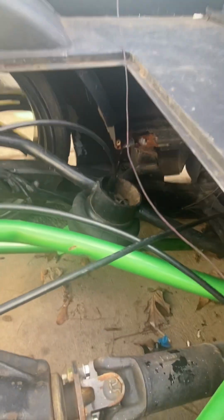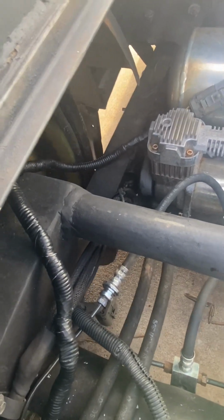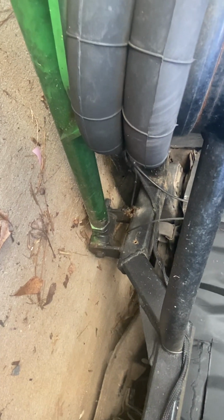As far as the welding job that has been done on the rear end and the 4-link and all that, it was done awesome, and nothing I believe needs to be changed. I don't think that any of that is bad at all the way through. Now the one 4-link bar down here on the very bottom, it is broken on the left hand side.